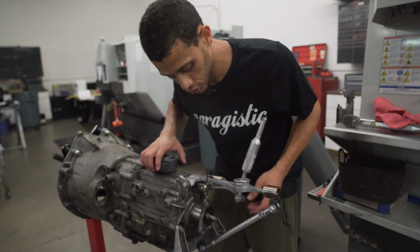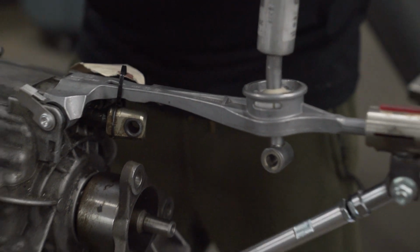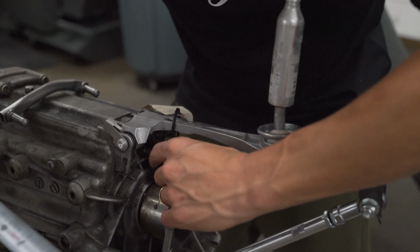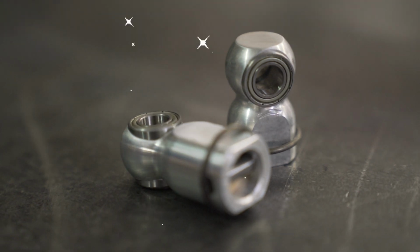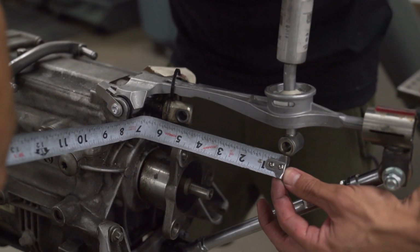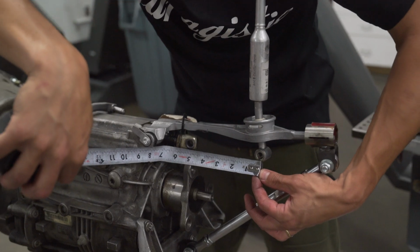Now if you don't, it's a motor swap, it's the same principle. So same thing if you don't have a selector joint. Again, you're just centering that in your shift boot and on your selector joint right there, which yours wouldn't be tired like that because you upgraded to the one that we make with the bearings. Center to center, right there. So in this particular case, a 5-inch would work on here. It's centered on both ends. Obviously, you have some adjustability on our adjustable DSSRs.